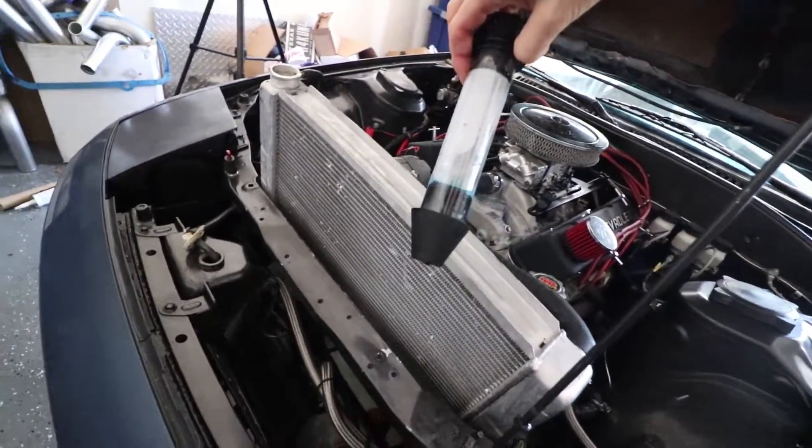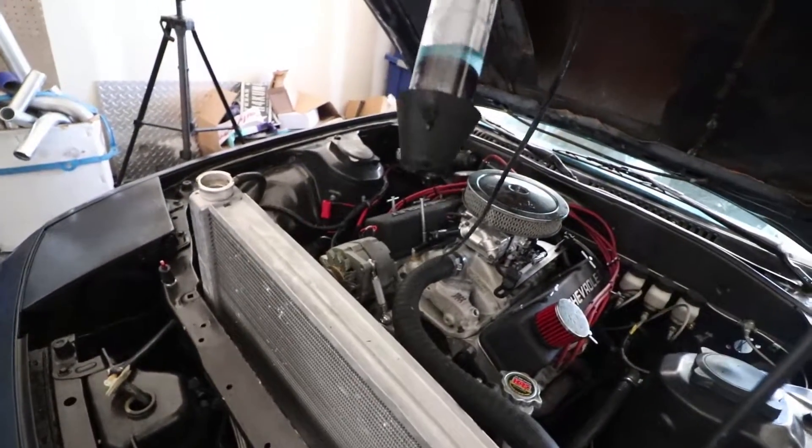Be extremely careful if you're doing this. On a positive note, the kit appeared to have not changed color, so it may not be a combustion issue. With all that being said, if any of you guys happen to know what else it could be — no combustion gas in the coolant tells me it's not a head gasket. We'll do a compression test and other stuff like that. But it's really weird. Just be careful out there guys, because this stuff's no joke. That was really, really bad. Don't be idiots like me — make sure you have somebody there to help you. And if your engine is putting out that much pressure, maybe you shouldn't do this test. I'm gonna move on to the next test.